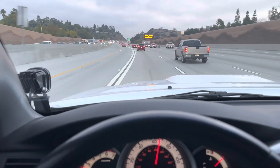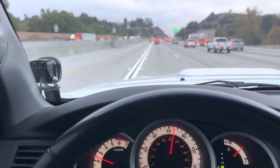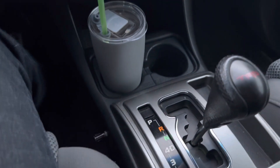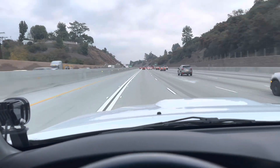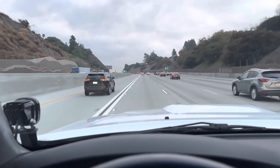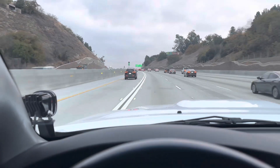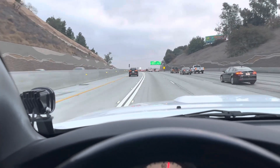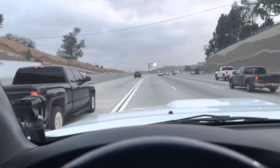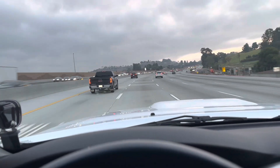I've gone about 180 miles round trip — this is my daily commute to work, this is Kellogg Hill with a pretty steep grade. Before the spacer this thing was constantly needing to be dropped from D to 4 manually. Now on this drive today it's staying in D and everything feels like it did when I had stock tires — the gearing is nice, the RPMs are fine. Driving up to Big Bear before without the spacer, I was needing to drop from D to 4 to even 3 at very steep inclines, and on my last trip it stayed in D the whole time.